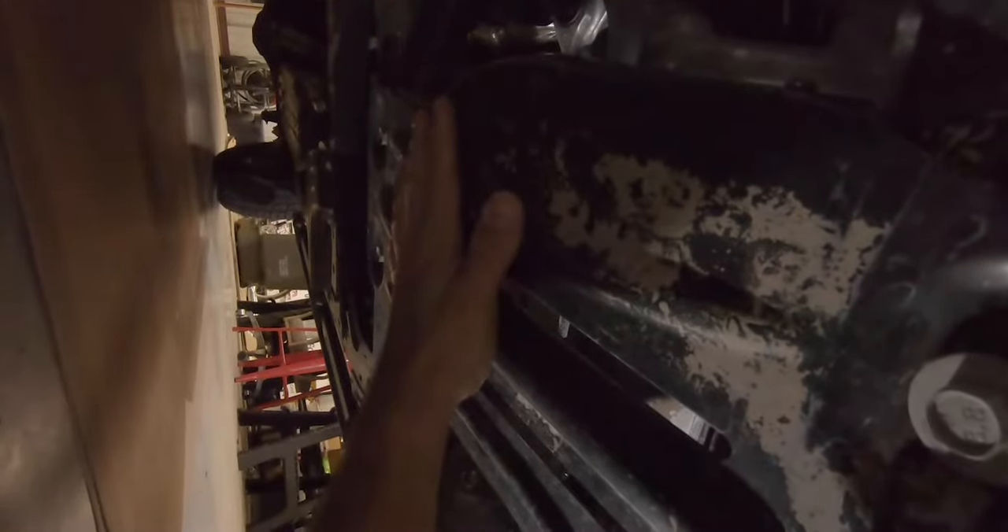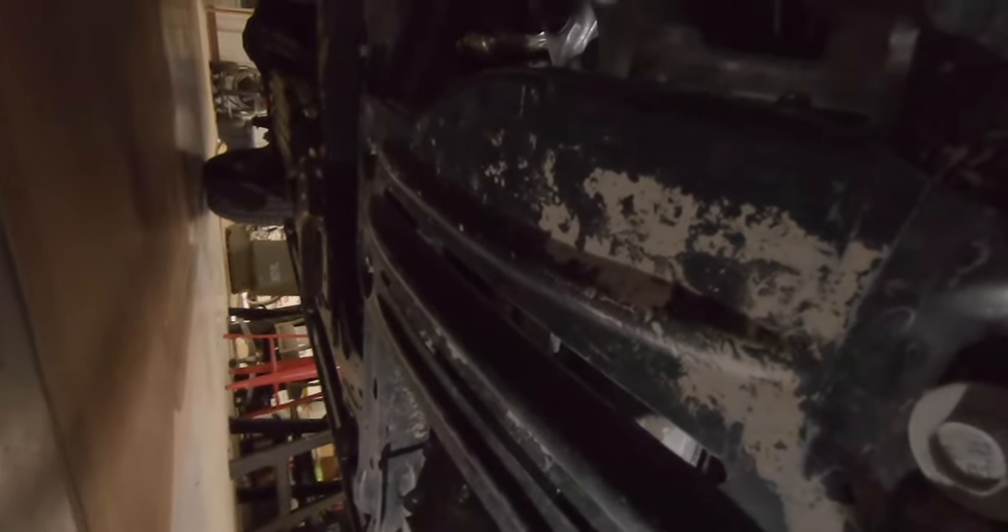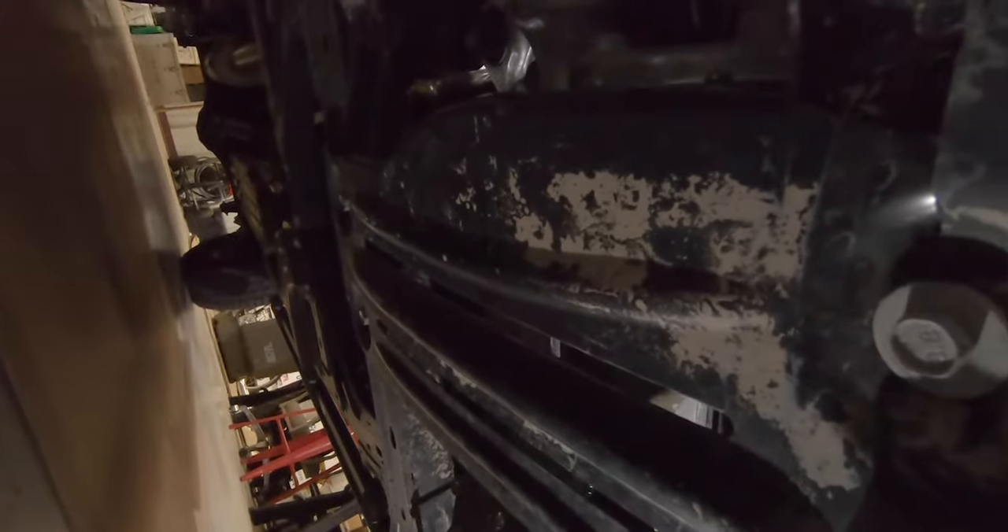I'm underneath the truck here, and as you can see there is a skid plate which covers the bottom of the oil pan. There are four 15mm bolts — 1, 2, 3, 4 — you'll loosen these up and take this skid plate off. I've changed the oil while leaving it on the first time I changed oil on this truck, and since the drain plug's on the side, it'll shoot out fine at first but then proceed to cover your skid plate and get oil everywhere. So it's real simple, just takes a few seconds to take this off and it'll make changing the oil a whole lot cleaner.